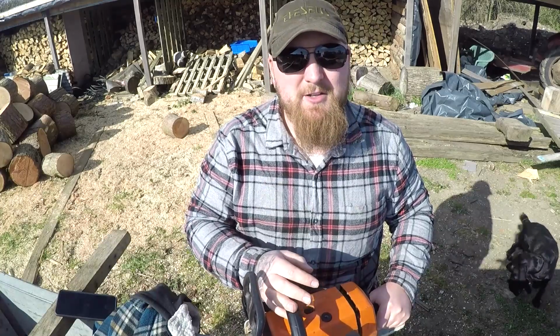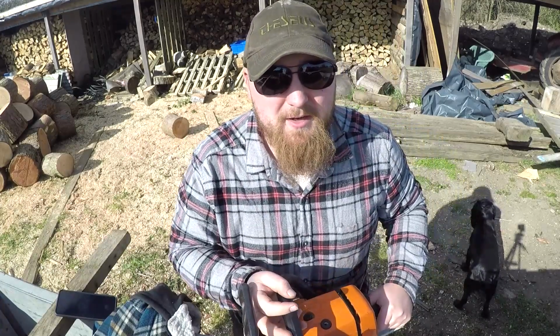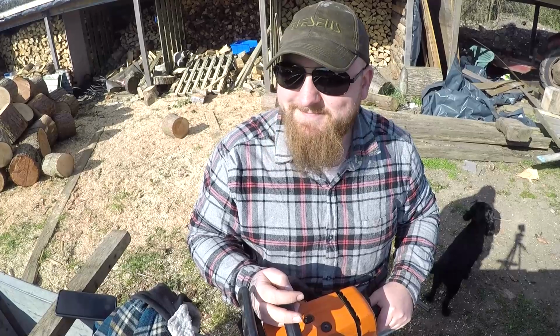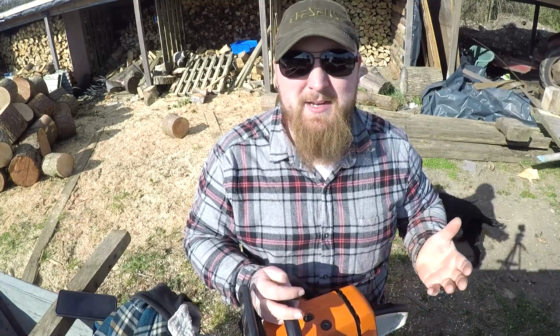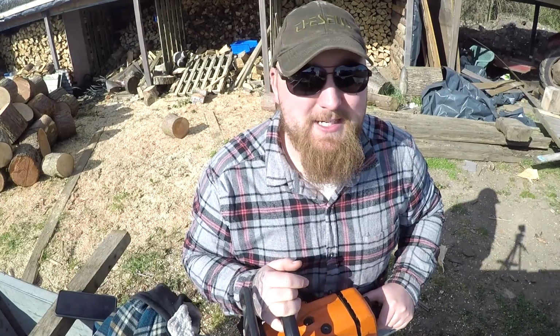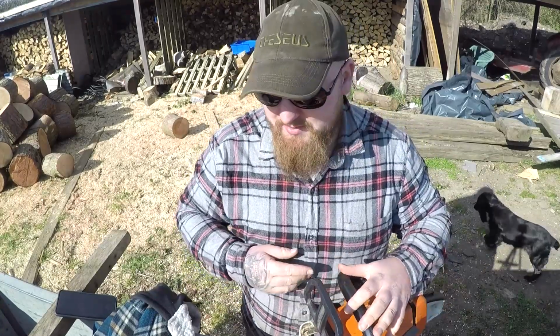Now, I was inspired to sharpen the chains by hand by Bushcraft Billy Ray on YouTube, and I was like, I fancy a bit of that. Oh, sorry about this wind, if it's causing any muffling. So I tried sharpening by hand, and I would have said I'd done a good job. The gullet was all out. He says, always get the gullet out. So get the gullet out. Felt like it sharpened the chain properly, but I think what I did was I used the wrong file size. Now I don't know how that's happened, but I have. Yesterday, after working with a 660 all day, I was just a bit tired of it.